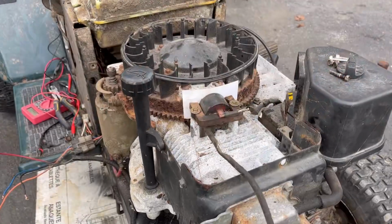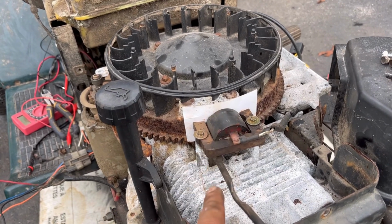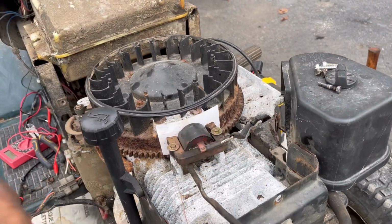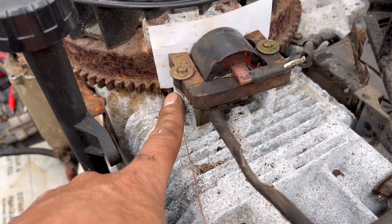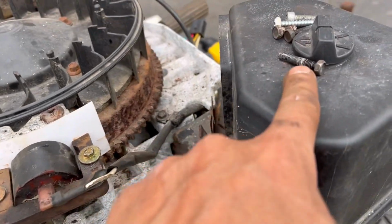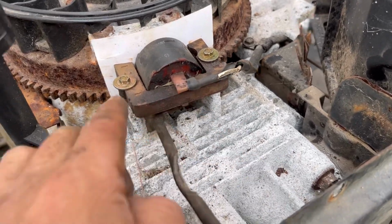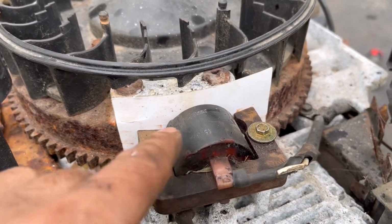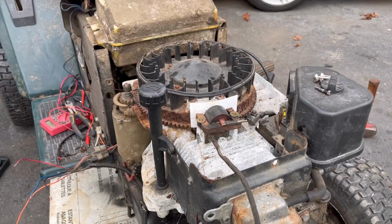Hopefully I'll be successful. So you remember what I said earlier about not fixing something that's not broke? I should have just left the old magneto on there, but I decided to change it because it was attached to the stator. I didn't want to go through that trouble, but now I went through even more trouble. So not only did I try to drill out this broken bolt, but I went crooked and it came out over here on the side. Over here, I tried to drill the regular one in there, but it stripped because it's soft aluminum. So then I have two posts that are not broken, but you got a bolt in there and that's stripped. So I just drove some regular screws in there and it's tight enough, gapped correctly. It's just gonna have to do, man. It's just a holder.